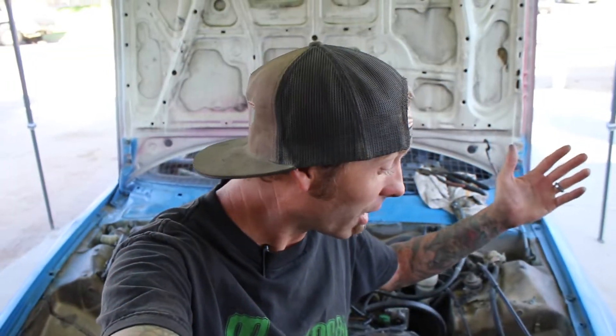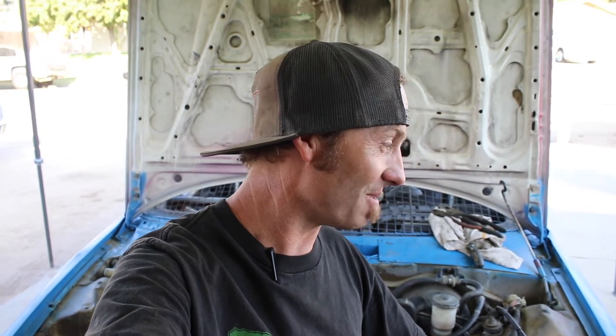I think we're to the point where we could try starting this thing. I'm gonna rob the battery out of my wife's car. I've plugged in all the necessary things to at least get it to run. We're missing a plug for the O2 sensor and the coolant temperature sensor — the computer needs those to know where to put the fuel map — but it should still run, probably just run like crap. I just want to see if it'll fire and if it has any knocks. If it starts and sounds bad, we go back to the drawing board. Let me put some gas in and see what happens.